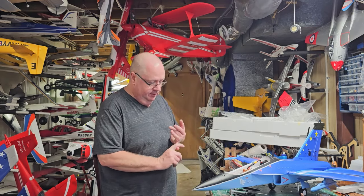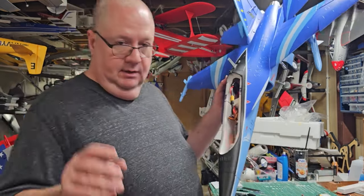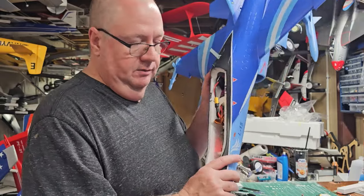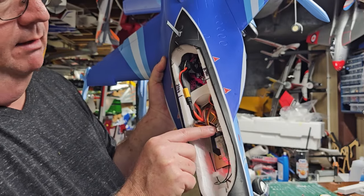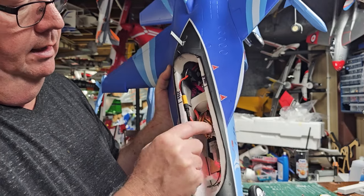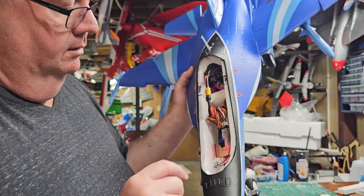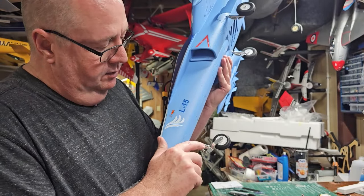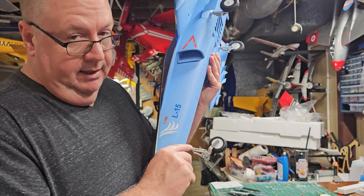Drawbacks: did not come with a thrust reverse ESC. I have gone through these wires — RC Castle, pay attention. You sold me this plane; it's supposed to have thrust reverse. There is my throttle cable plugged into the top of my receiver. There is no yellow signal wire coming off of this throttle cable anywhere that will give me thrust reverse. Also, RC Castle, there's a pin that's supposed to be installed in this articulating gear for these grub screws to hook up to. There was no pin in there; I had to manufacture my own — take a piece of Allen wrench, cut it down, and put it in there. That's bang on y'all for not making sure your model is complete before you sell it.